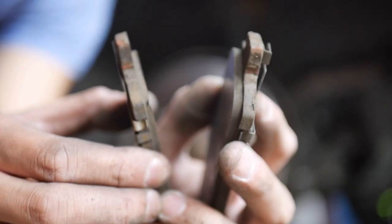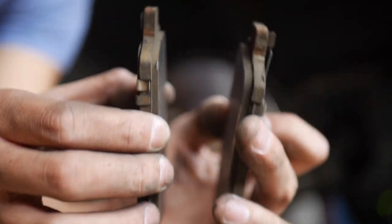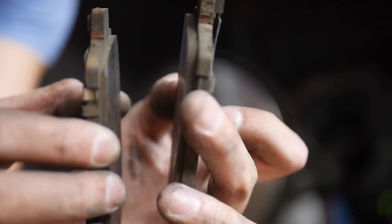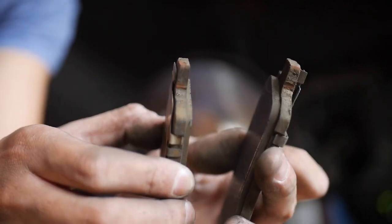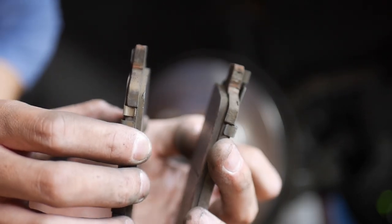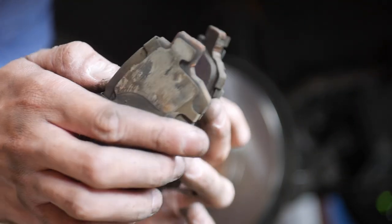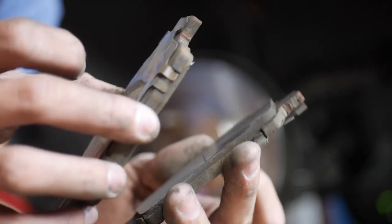You can see I got the old pads out — they're pretty equal on both sides. If yours are not equal, it's because the adjustment screw on the caliper that controls bite on each side is messed up. Mine looks like it hasn't been messed with or was done correctly, so I'll leave it. The caliper bolts were 14mm and I had to remove the brake line to remove it. Go ahead and put the new pads in.